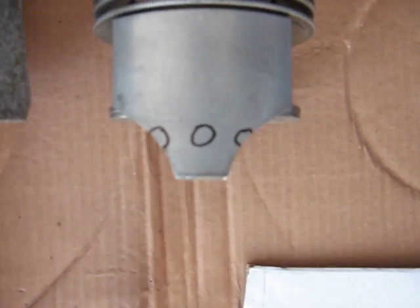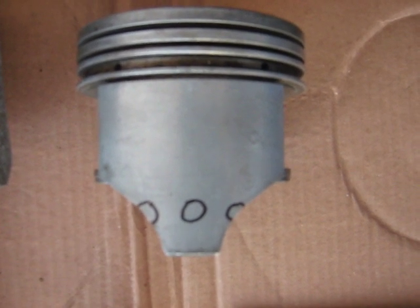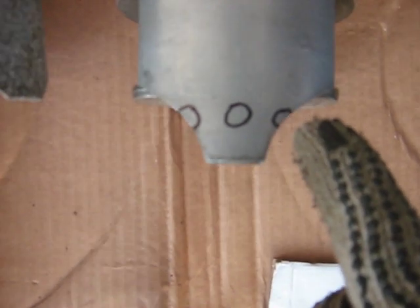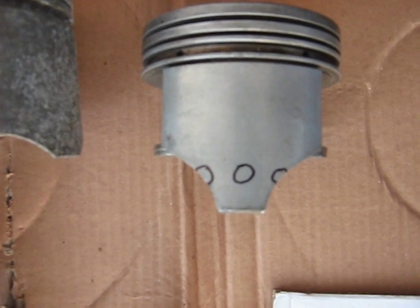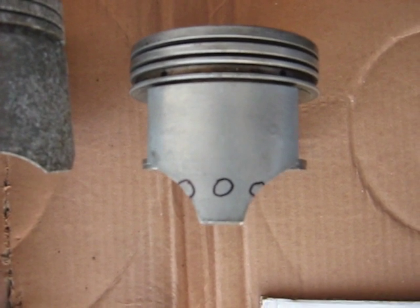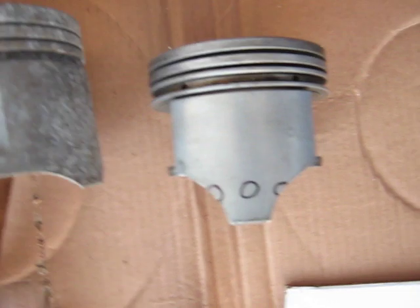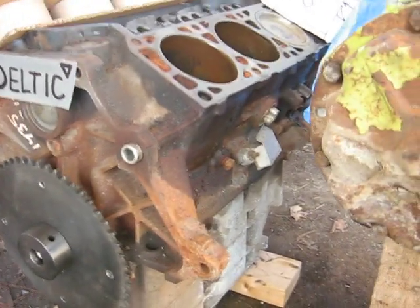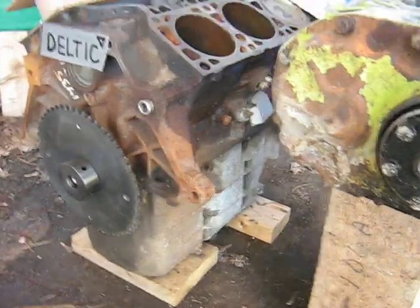The problem that creates is: as I've shown here, you've got three inlet ports — holes drilled in the block — and when the piston is at the top, the hole will be uncovered and let supercharger air flow into the crankcase, so you'll lose boost pressure into the crankcase. Whereas if you had full-skirt pistons, that wouldn't take place. I haven't pulled this V6 apart, so I don't know what the pistons look like, but I suspect they are probably something like this 327 piston. That's one design difficulty you've got to work around.